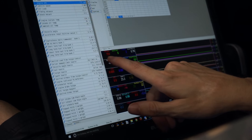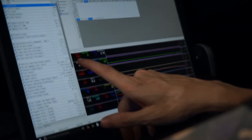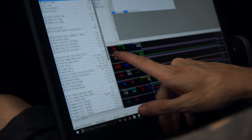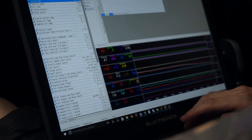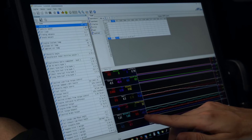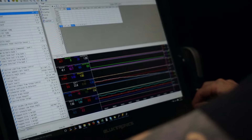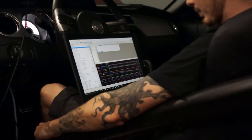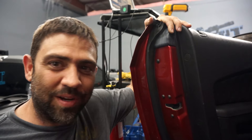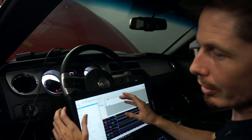I'm going to land around 740 RPM — I did break the idle slightly on the E85 plans. Just look at those numbers and you can tell how smooth this idle is, fluctuating by only about 20 RPM. We're still around 10% off at 140 degrees. It's looking really good. It sounds quieter and it's running a little smoother than it was with the 91 in here.